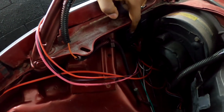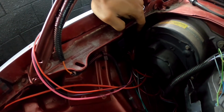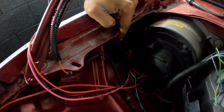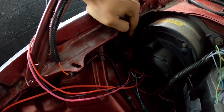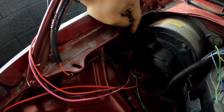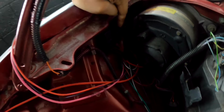So right now I have 1 and 3 powered, okay? Relay bank 3 powers the fuel pump. This first one powers the fan, okay? I don't have the second one wired in yet. It'll more than likely go to one of those accessory switches, but it'll be for the fan for my transmission cooler, more than likely, okay?